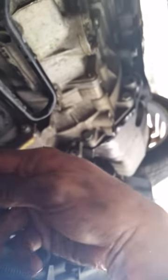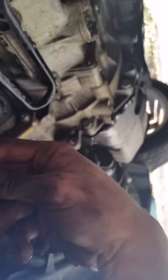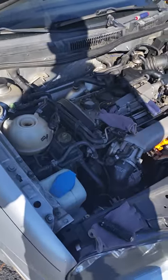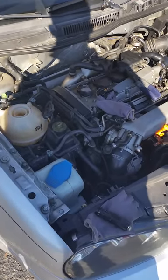We're going to close the drain on the bottom here. When we put our coolant in, it doesn't just flow out. Another thing to note is that when you're replacing the coolant you need to use the Volkswagen G12. Mixing two different coolants can cause big problems — I think it can cause some coagulation and clog your system. Regardless, it's not a good idea to mix your coolants; if you do, you want to drain it and put your G12 and distilled water 50/50 back in.